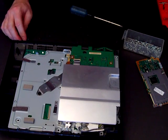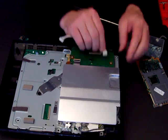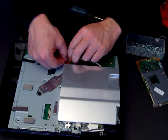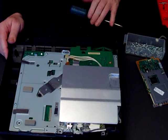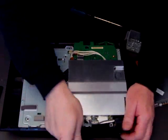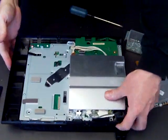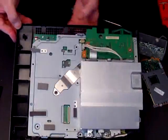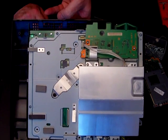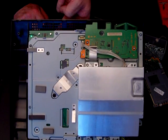Okay, now to test that the motherboard is working. For speed I don't need to connect everything up again — I think that's probably enough. Just reconnect the power, make sure the switch is off, plug it in, switch it on. The red light comes up there — see that red light? Hit on, it's gone green. The fan's running. Everything's hunky dory.